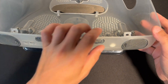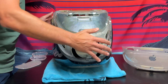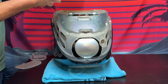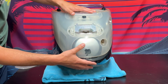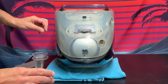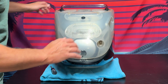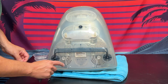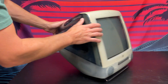Future Pete here — that clip seems to be held together pretty well, so let's continue with the reassembly. I'm going to align the two clips in the front, make sure they're in those slots — and it sounds like they both went in and the casing slipped right in. I'll reinstall those two Phillips head screws by the video out port, pop the grill back in, then reinstall the remaining two screws. The casing is reinstalled and looking pretty good.